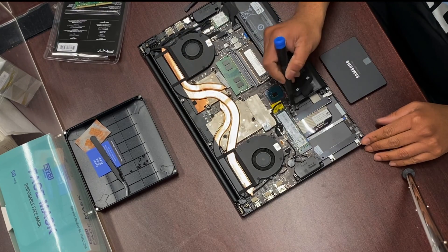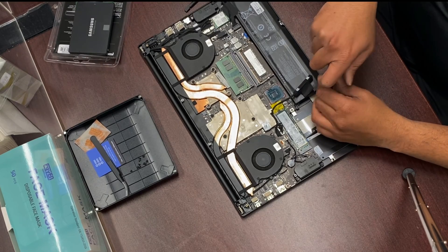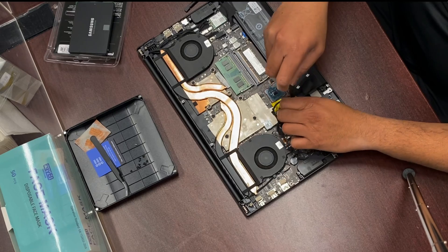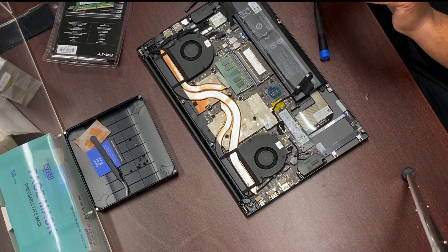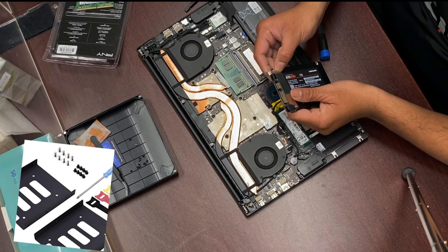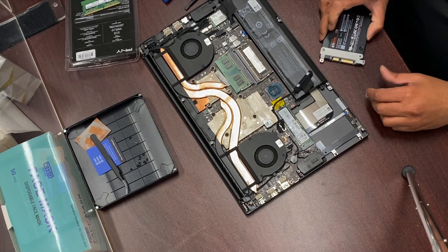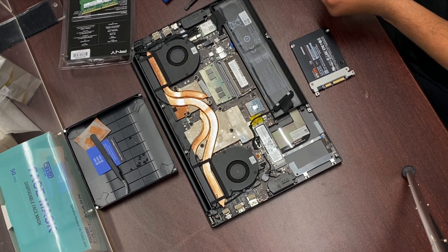Here is the part of the SSD install. This part requires care because there are two brackets and four different screws. Out of four, two screws are of different size — there's a silver screw and a black screw which is a little bit longer than the silver one. I've kept those two parts separately and taken the bracket out. One more thing I forgot to mention: you have to pick up something called a desktop SSD mount, because those have the screws that actually screw into an SSD. Your laptop will not include those screws. The screws I'm now using are from that desktop SSD mount — I'll post a link down below.